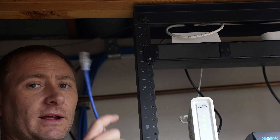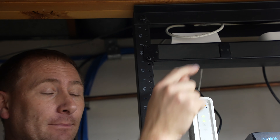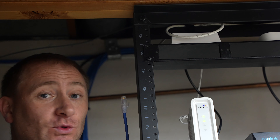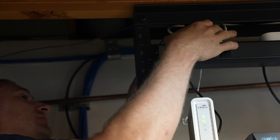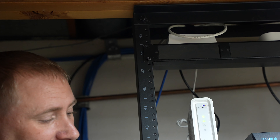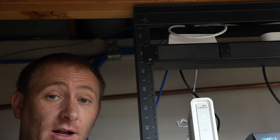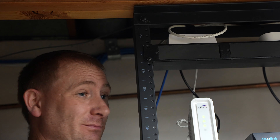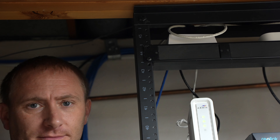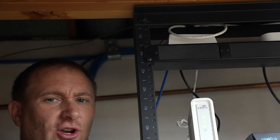While we're waiting — if you want to connect a switch to give you more ports than just the one LAN port, this cable here is just running to one of my switch ports, and I can plug that into the LAN port — the second port — and just run it down to a switch. Now if it's a managed switch you have to correctly configure that, but if it's an unmanaged or standard switch you got from Best Buy or wherever, it's an easy setup. I'll probably put links in the description for a decent 8 or 16 port unmanaged gigabit switch as a good addition to this.